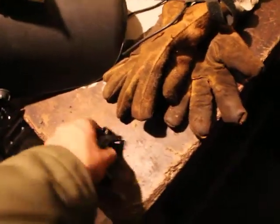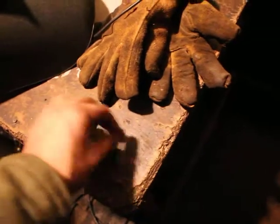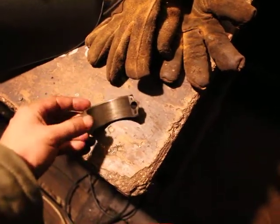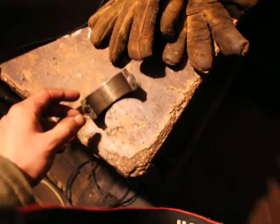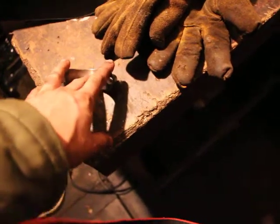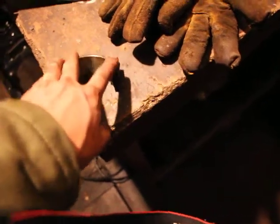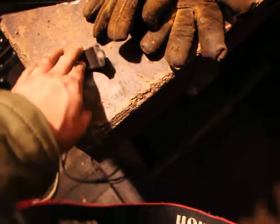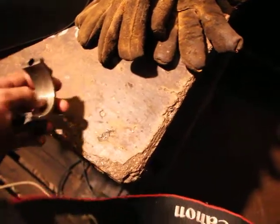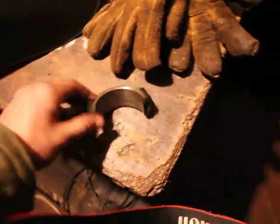But okay, it might be fairly easy for you to remove the oil pan if you have a modern car, but changing a head gasket is literally, for most cars, thousands of dollars and a long time. On these classic cars, especially the L-head engines, which are also called flatheads or inline, it literally takes like 15 minutes to remove it, right? So in total, let's say you're new to this and you're afraid, you're looking at no more than 3 hours, okay, guys? 3 hours is a really long time for this project.